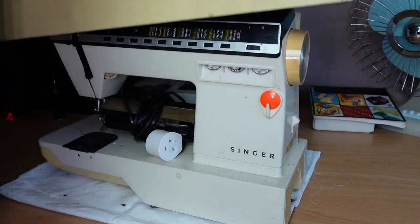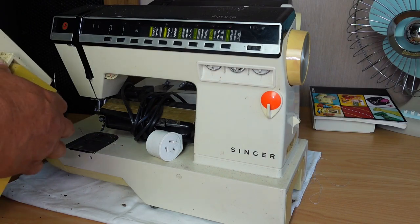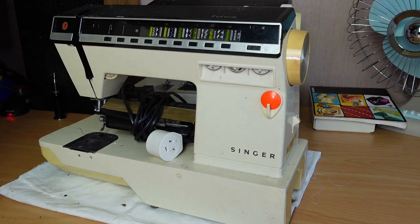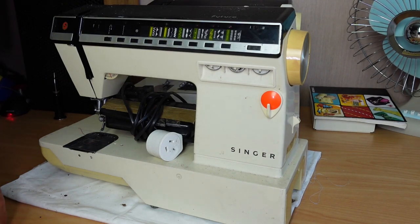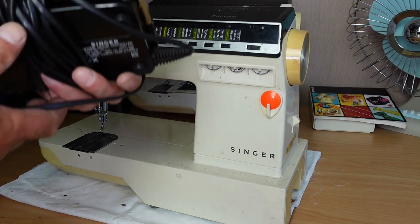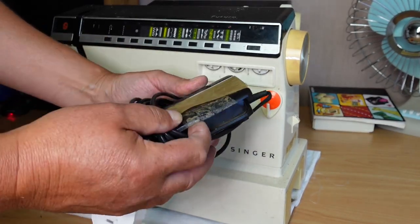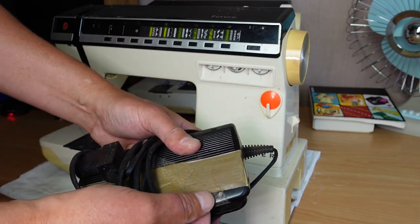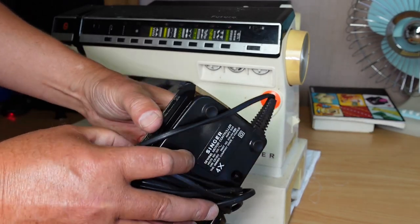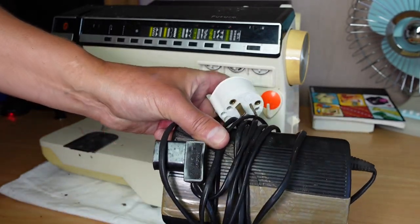This one looks like a German model. I've got a note on this one that says 'electronic issue, foot controller blowing capacitor, goes, clean electronics' - so probably referring to cleaning the button contacts. I won't plug in that foot controller - it's cracked. I wouldn't use a foot controller like that because all it takes is for that top lid piece to break off and that exposes live contacts right under your foot. That's probably only good for parts, that controller.